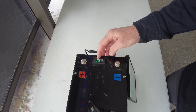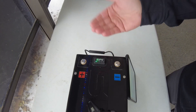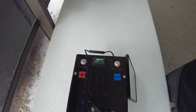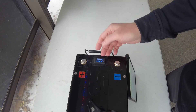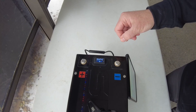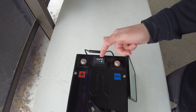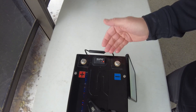There are five modes on this switch. Mode 1 heats the battery up to 68°F and then regulates on and off to maintain 68°F continuously — 24 hours a day — until you manually turn it off. Mode 2 does the same for 77°F. Mode 3 does the same but targets 86°F. Mode 4 regulates to 75°F for 12 hours and then shuts off. Mode 5 regulates to 75°F for 24 hours and then shuts off.